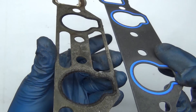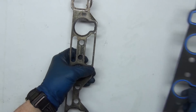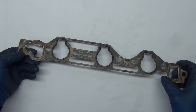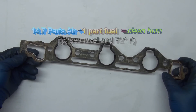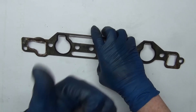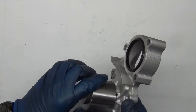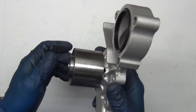If you don't have a good seal, extra air gets into your engine and it throws off the air-fuel mixture — it's just like a recipe for baking a cake. If too much sugar or flour went in, it would ruin the recipe. When you have an air-fuel mixture of 14.7 parts air to one part fuel, you have stoichiometric balance — everything can burn, giving you the right number of molecules for good power and good economy. If your vehicle is too rich, it'll blubber and lack power. If it's too lean, it'll get really hot and overheat and burn things up. Ultimately, when you overheat a vehicle, you cook all your seals and everything leaks — pretty much everything on the outside and top of the engine tends to leak.